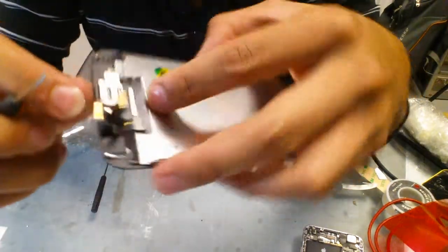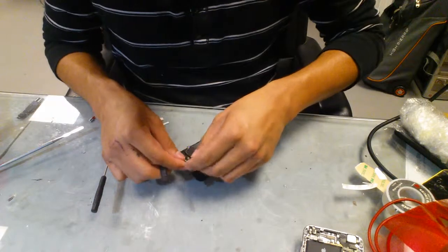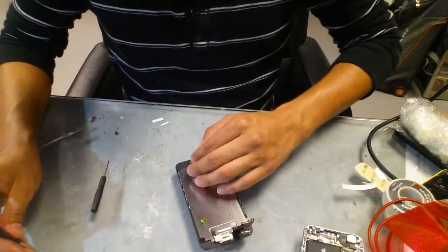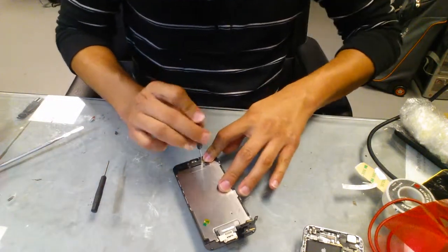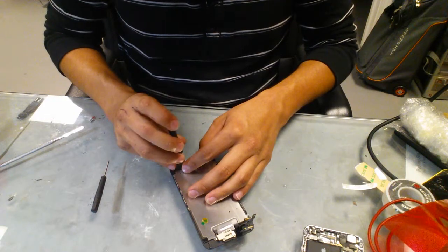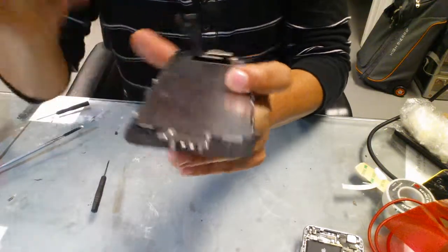So once the screws are in place, everything should look flat, no gaps in there, nothing. And we go ahead and place the home button cover. Home button cover right in. Make sure you match the holes in it, everything covered. And then the screws back in it. One, there's two, and then the one that holds the frame. And it's in place, buttons clicking. So again, once you put the screws down, no gaps, no holes, no nothing, everything has to be flat.